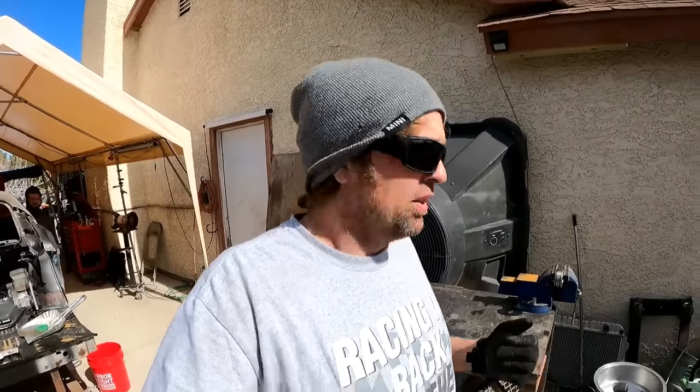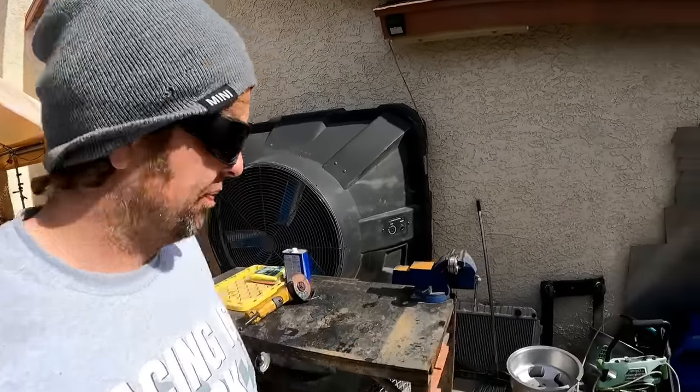And the reason that these aftermarket brake companies want you to run the ball bearing is because it's easy to adapt their brakes to. They don't have to make you take the bearing apart and put a spacer in there to shim the bearing to allow for the thicker backing plate. No, they're just taking the lazy way out. So anybody at home can bolt their backing plate to your rear axle and run their brakes, instead of actually taking the axle apart and shimming the taper bearing so that it'll work with the Wilwoods.